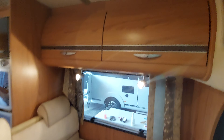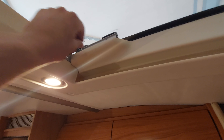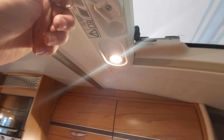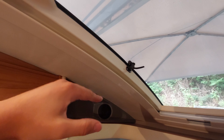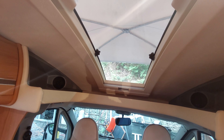That returns you to your lounge — there's a really good bit of storage in here as well. Above in the living area you've got a really nice-sized roof vent. To open it, turn these plastic catches, unwind them like so, and that will open everything up. All you've got to do is wind it up and that will allow a little bit of airflow through. Please ensure that when you're travelling this entire roof vent is sealed correctly, and ensure these clips are clipped in all the way — you don't want any wind getting underneath when travelling as it could rip off the front section.